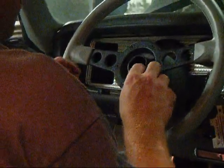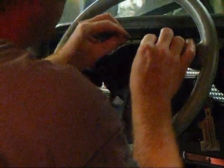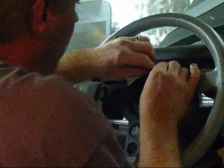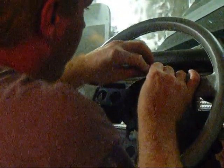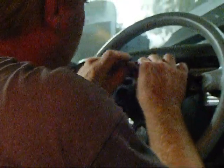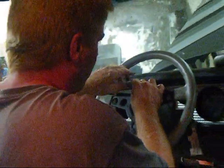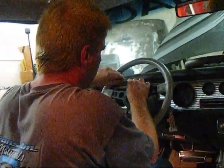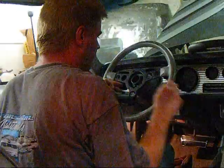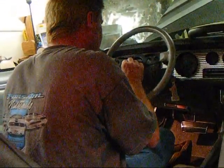The next thing you're going to note is you have a series of six little Allen head bolts that hold the unit on. All you do is feed into the hole and turn to loosen, and these will come pretty easily. Always leave one bolt towards the top for last so when you undo the bottom screw, the steering wheel doesn't flip and slide away from you.